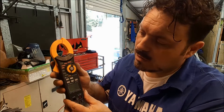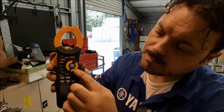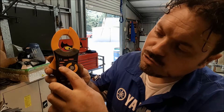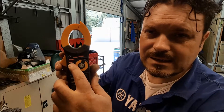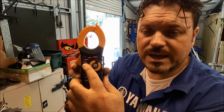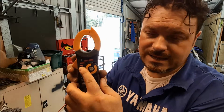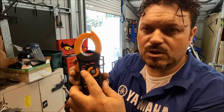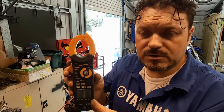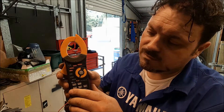To use this tool — and I'm doing this because it wasn't that clear on the car — you need to turn the dial from the off position, and we're going to use 600 amps DC. All alternators nowadays on cars produce a DC output. They have an internal bridge rectifier that converts AC current to DC. So what comes out of the alternator on that big thick single wire is fine to be used in the loom, it's fine to charge the battery up — it's the correct voltage type.